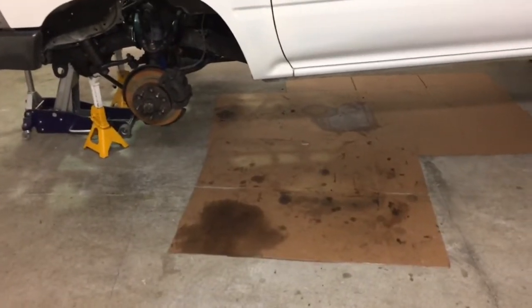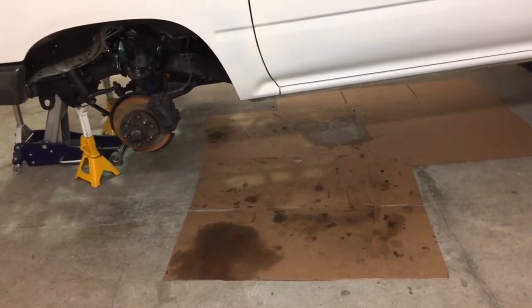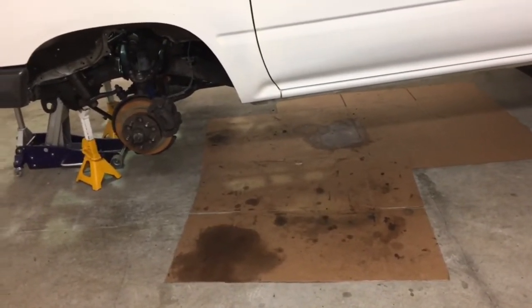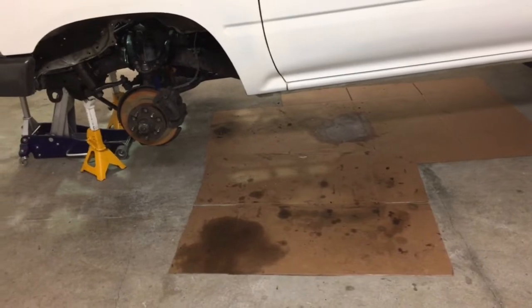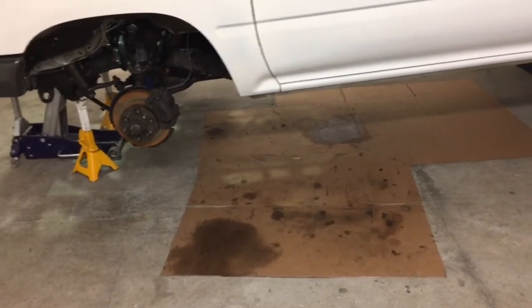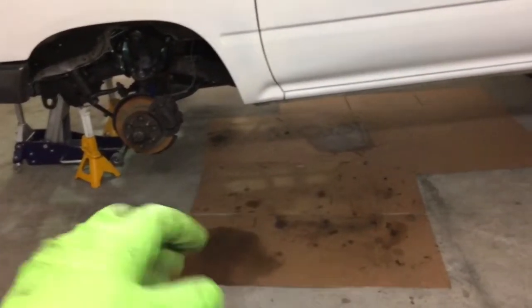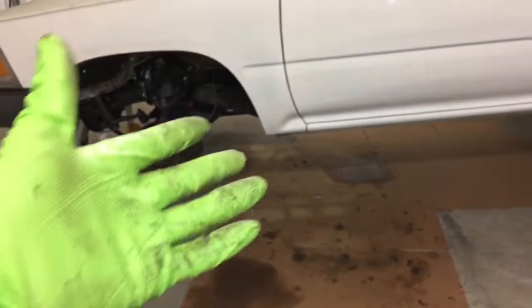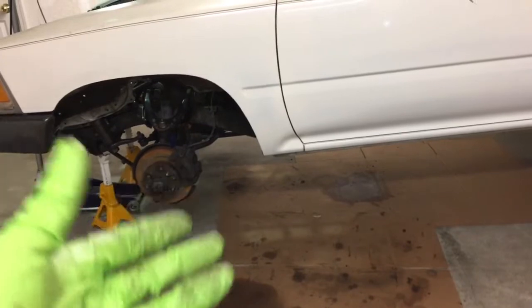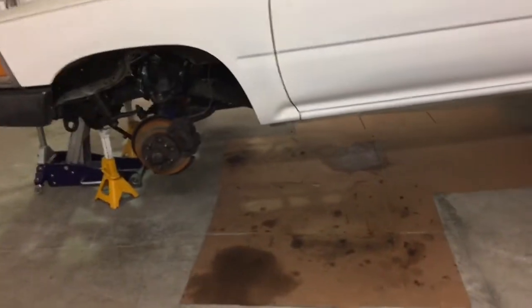I remember once when I was a kid, I had a souped up Datsun 510, and one summer I broke 3 pressure plates by chirping second gear at full throttle. So I used to swap the pressure plate out while the transmission for the car was resting on my chest. I would lie on my back, and I knew what wrenches I needed, and I would reach over, grab this one, slip the new pressure plate up, bolt it on, and do the whole job with the transmission resting on my chest. Then I would heave it up and get the input shaft in and bolt everything back. So I got pretty good at doing it.